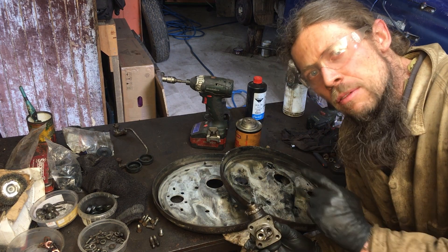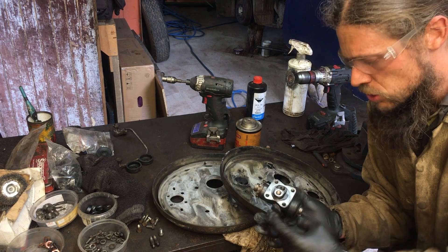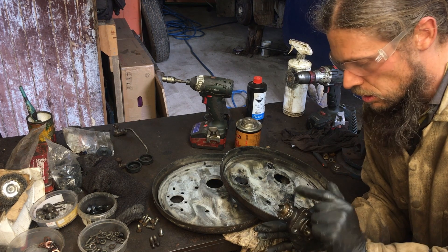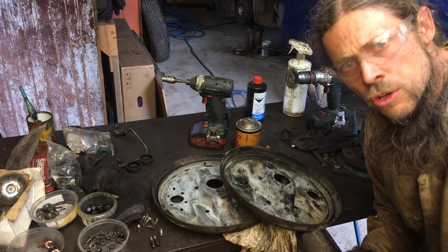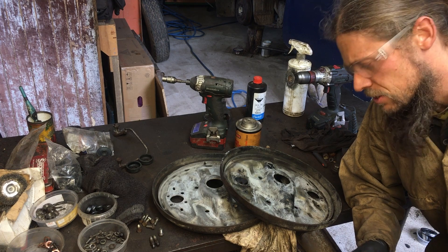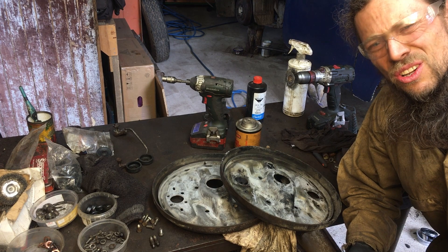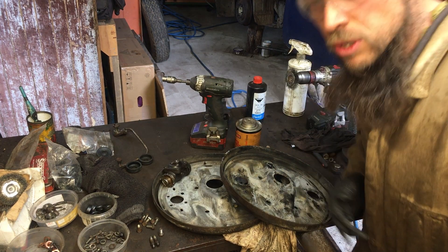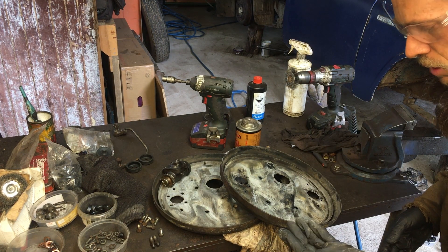It's not actually doing anything, this one. On the back of the vehicle they're double-acting, and on the front they're single-acting, which means there's just a piston pushing in this direction — this is just an adjuster, no fluid in there. Because this is a ute, it's got most of its braking on the back, unlike a passenger car that has most of it on the front. Unless it's got a load on it, it's really easy to lock the back wheels up. Fortunately, we have a load on it most of the time, so it's well-balanced.